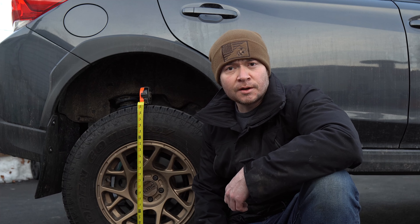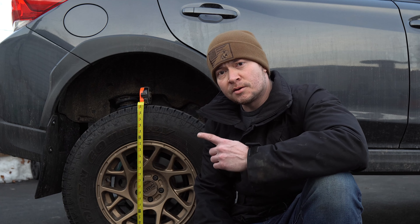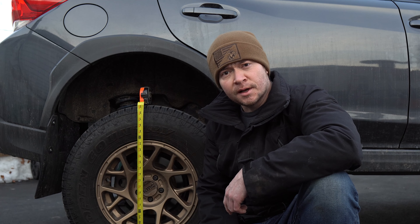But there are some things to look out for. Right now I suspect I'm pretty much fully extended on my struts, and so perhaps if I had longer struts I could get a little bit more articulation out of this still. Also, the brake lines are pretty close to being maxed out as far as the rubber part being stretched. So if I did end up going this route long term, I'd probably get some extended brake lines too.